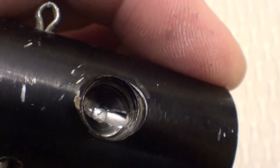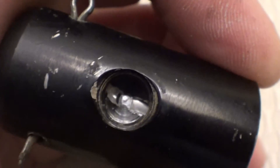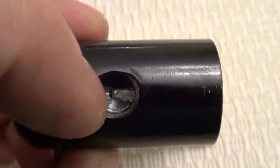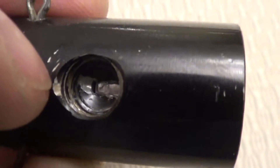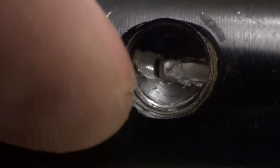The piston moves down — see how it moves down — and there's an O-ring right there on the top. You don't want to drill the top, which would be the left side. Try not to damage the aluminum there; I damaged it a little bit.